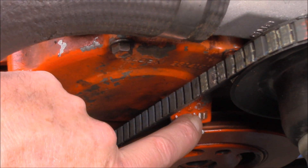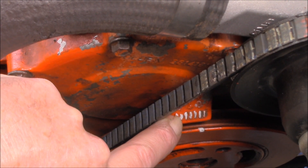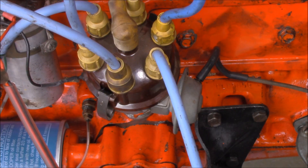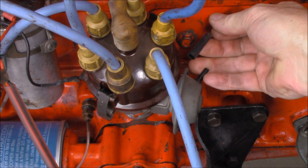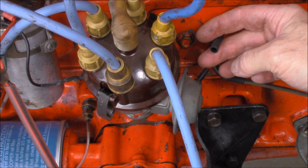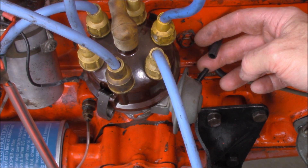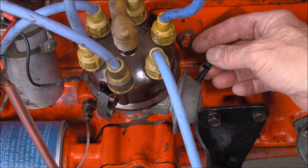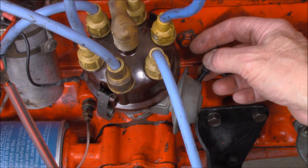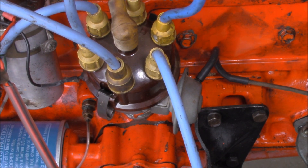We're looking at 8 degrees - two, four, six, eight - that's our 8-degree mark right there. When checking your ignition timing, you may have to remove the vacuum advance hose. It depends on the manufacturer's specifications - if it's an automatic you generally leave them on; if it was a manual you pulled them off. We'll find out shortly when we hook it all up.